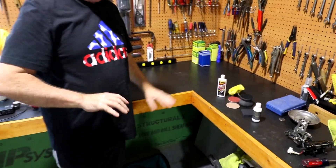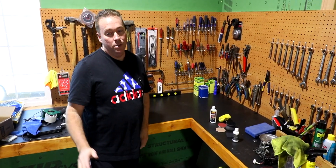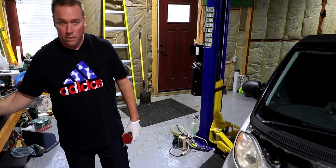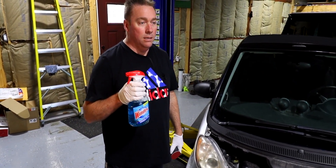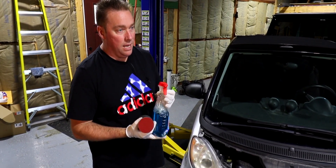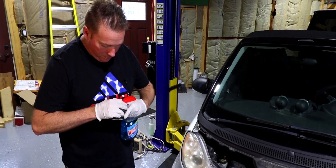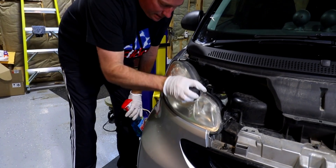You could do it in a couple of minutes with only a drill — you don't need an extension cord at all, it's real easy. We're gonna start off with a microfiber towel on standby. I like using Windex on these — it's just easier. You can use soapy water, regular water, whatever you want. The Windex is already in a spray bottle, we're just gonna mist it. We've got our 1,000 grit on here — we're gonna go in and just sand.